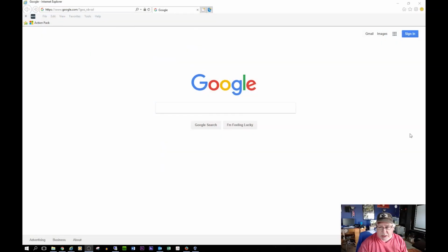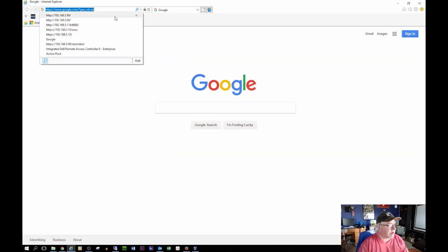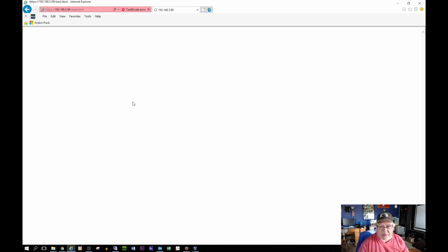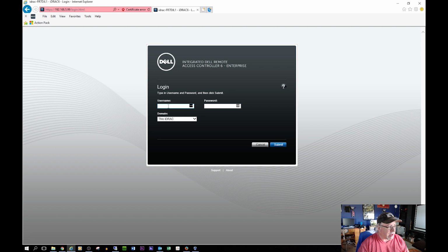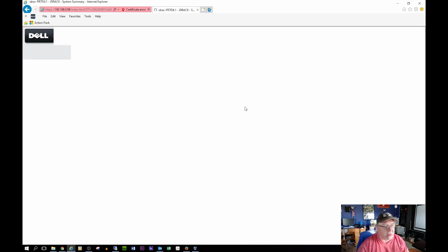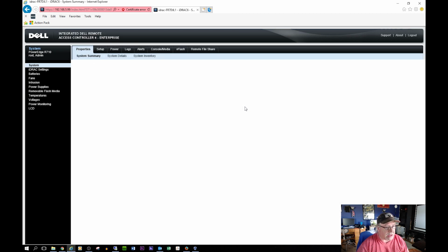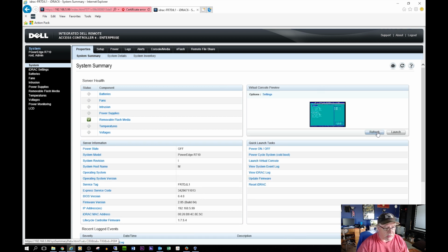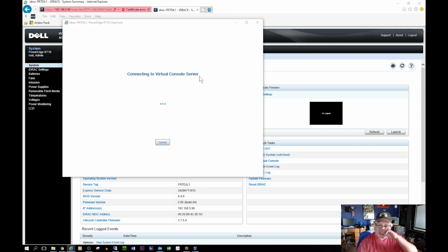Let me take you with me. I have to take you over to Internet Explorer for this one because it is a Java-based whatchamacallit. We need to log in and boot this machine up and go in and redo the iDRAC configuration so that it will boot properly. So let me refresh that. I'm going to go ahead and launch a virtual console here.